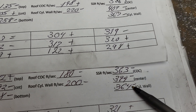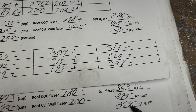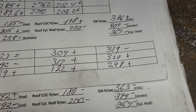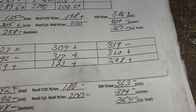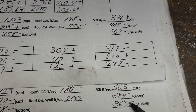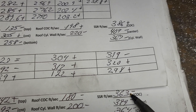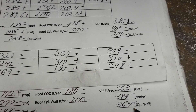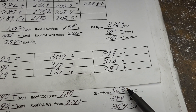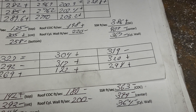This is what we had on the short side — it wasn't bad, but now it's better. Look at how the speeds are from side to side — that's tough to beat. I put a flow ball from this corner to this corner as well, and I want to see which side gets knocked down more. You'd think it would be the faster side, but it's not — putting it across the inside, you drop a lot more CFM than on the other side. So your inside center of the cylinder is definitely important.